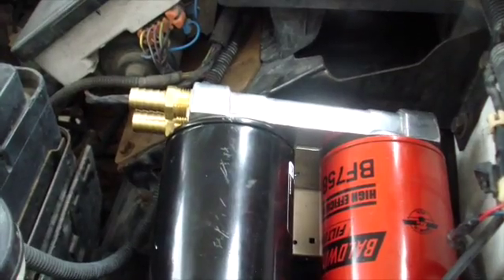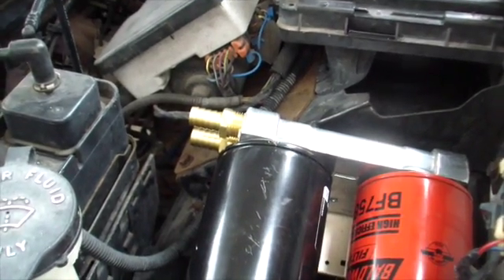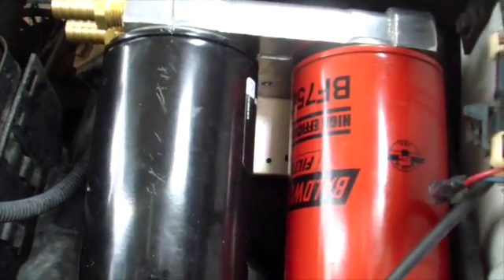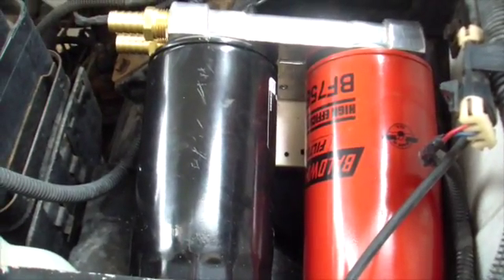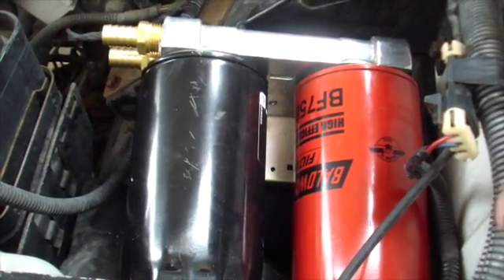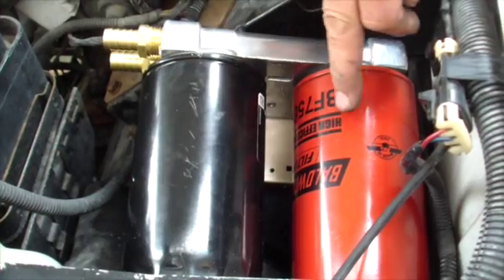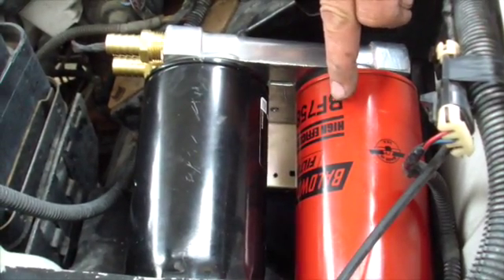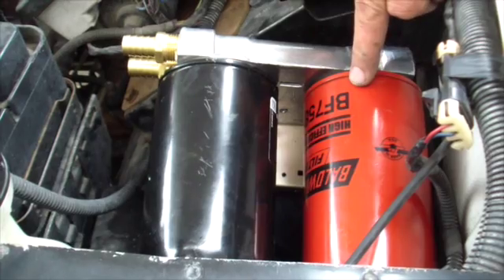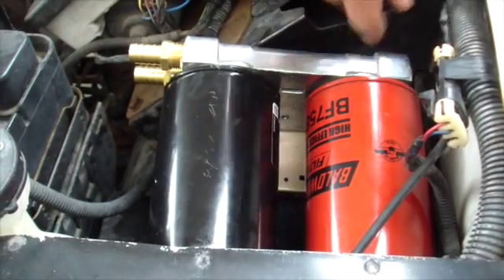We're making the 12-inch tall filter assembly fit into the existing space. We really don't want to leave it prototype, so we're making an aluminum bracket from scrap that will secure the assembly and at the same time make it easy to change the filters when the time comes, which is about a year. The full-flow filter should be changed every year, and you could let the 3-micron absolute filter stay on for two years or 40,000 miles. Not much oil flows through it to totally clean the oil, but it will plug up in about 40,000 miles.